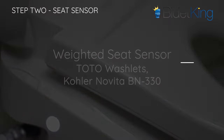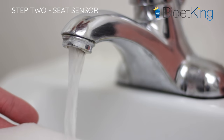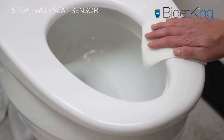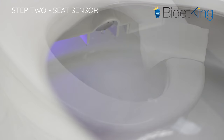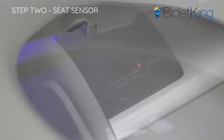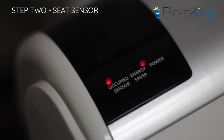If your bidet seat has a skin sensor, we can trigger it using a wet piece of paper to simulate skin contact. First, take a folded paper towel or a few sheets of toilet paper and get them nice and wet under your sink. Now, standing in front of the toilet and looking down at the seat, imagine a clock face overlaying the seat. Place the dampened paper in the 4 to 5 o'clock region of the seat. At this point, you should hear a bit of water release from the nozzle and drip into the bowl. This is a good sign as the nozzle has just cleaned itself and usually means the sensor is triggered. Some models have an indicator light that shows the sensor is triggered.